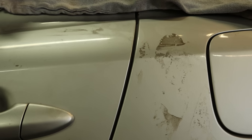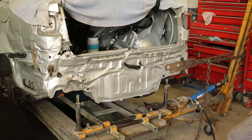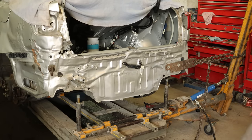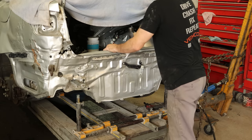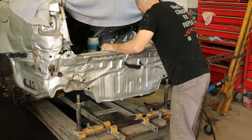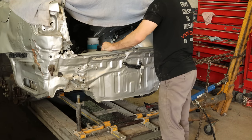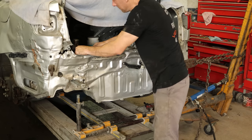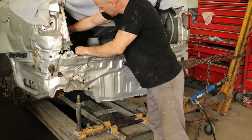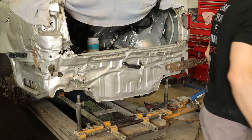This gap opened up quite a bit — much better than the overlapping door we had before. Now we're just going to pull it straight to the side. We bolted it where the reinforcement bolts go. We're going to pull the passenger side first — it's going to pull the driver's side just a little bit, but not too much. There's not a whole lot of strength in that rear body panel to bring it with. So we don't have to worry about what's happening on the left side while we're moving the right side. We'll do one side at a time. Since everything is still connected and there is a brace across the floor, we're going to stress relieve the other side just in case there's any tension left in there — we don't want it moving later on.